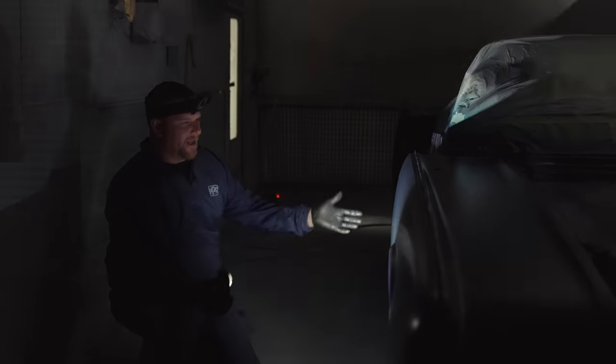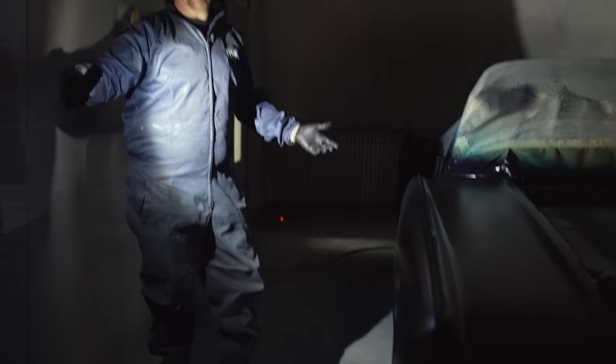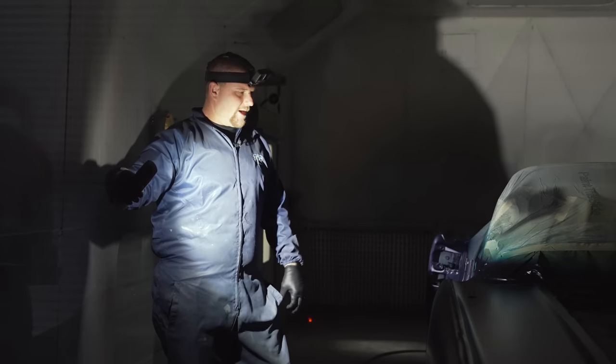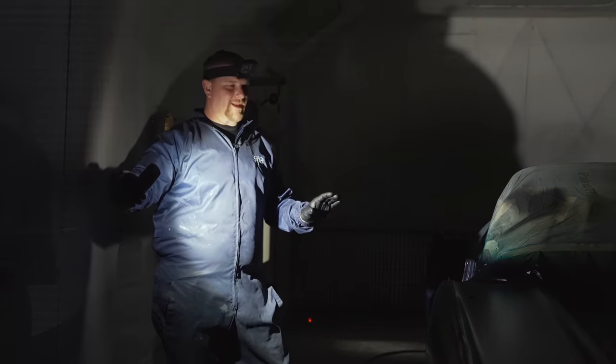we are moving it top to bottom, side to side, and we just are looking for any inconsistent paint patterns. If you see a stripe, if you see a flake where it shouldn't be, whatever it may be, we want everything to look completely uniform before we jump into doing the clear. I've gone around, we've verified everything on this car is ready to go. We do have to make sure this is completely dry. I can't stress that enough.